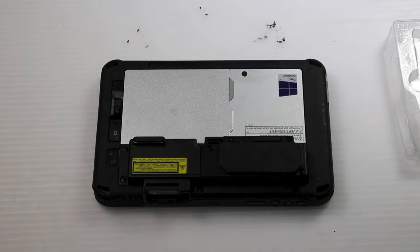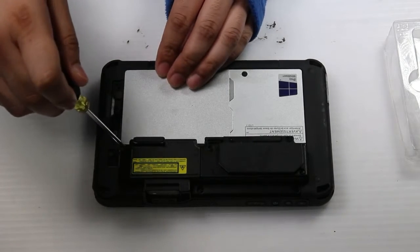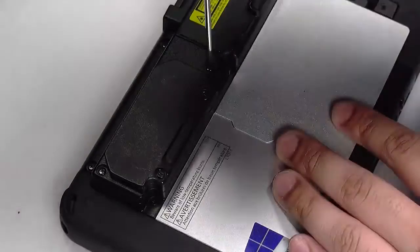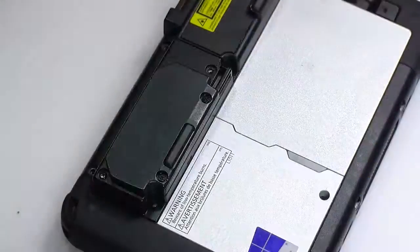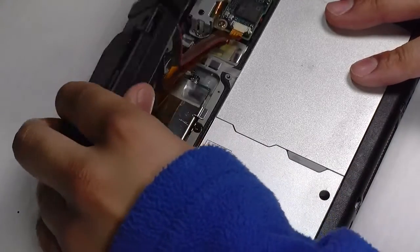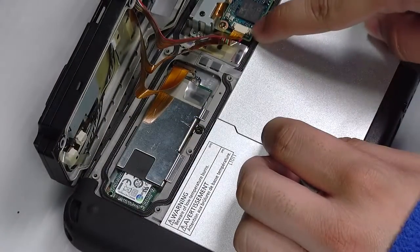You want to get underneath those two. There are six screws that hold it down here. Once you remove those screws, you just want to be careful prying it up. There are two ribbon cables connected — you just want to unlatch those two.